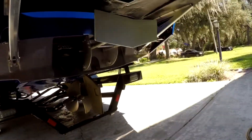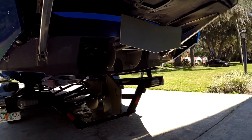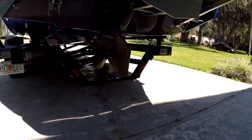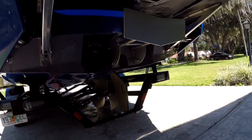The main thing is these engines — PCM does suggest that you change your oil and your impeller every 50 hours. Just do it. Don't argue with it. They know what they're talking about, and the amount of performance you put on these engines, you need to change them every 50.